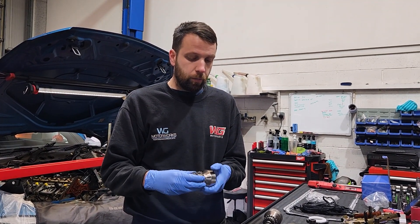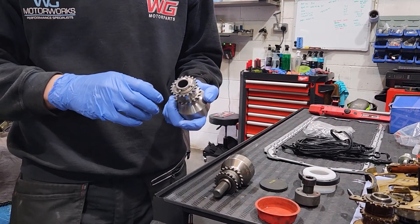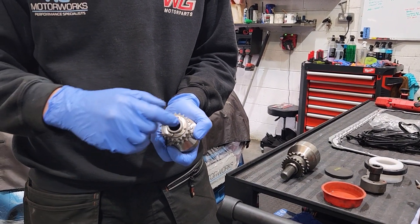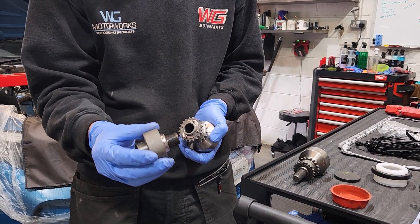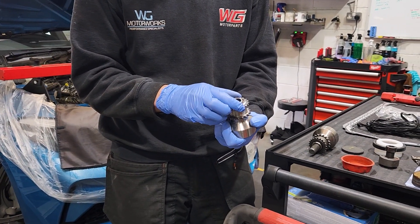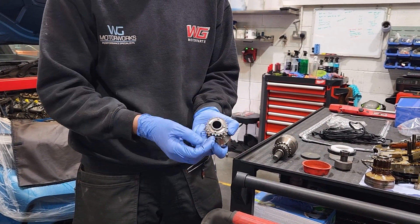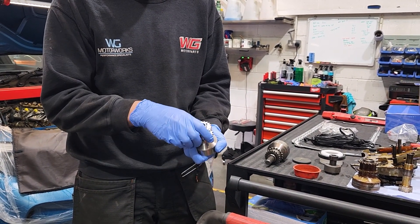This is the Insane 4-pin hub. There are a couple of options when it comes to hubs. You get some that are just a one-piece but with no way to lock into the crankshaft. You get some with a little keyway. And then you've got this one with the four pins. The whole idea is you use a special tool, bolt it into the crankshaft, then measure and drill into the crankshaft to allow the pins to physically lock in. The only way it could ever fail would be if the pins sheared — and there haven't been any failures. There are two and four pin options, but four pins is obviously more balanced and stronger, and doesn't cost much more. So for us, it's four pin every time.